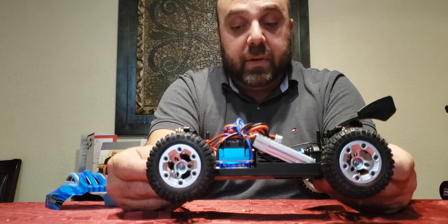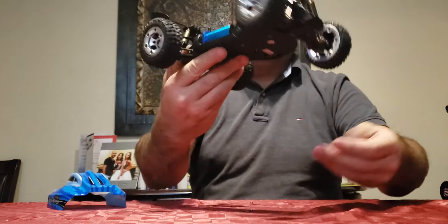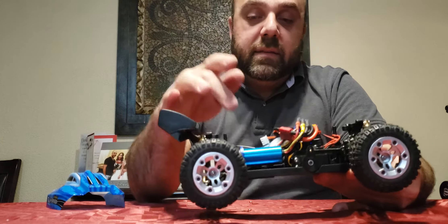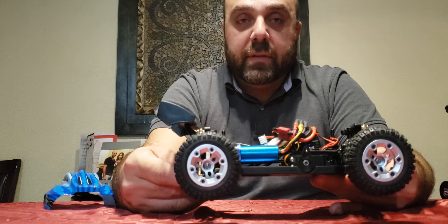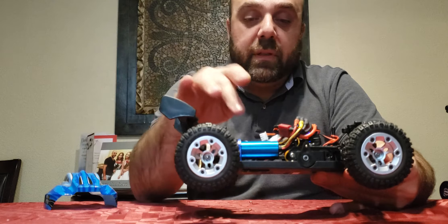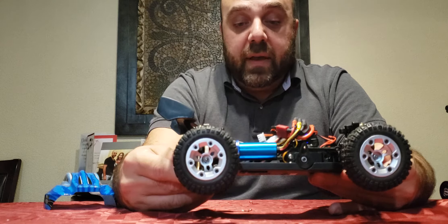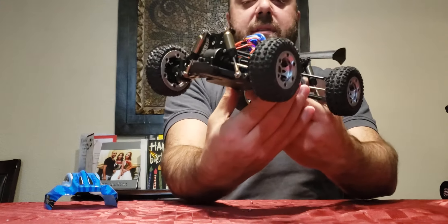I've tested this on 3S already just on the bench and it actually works, but the wheel speed is just way too much — it's insane. Over on this side I added a 2040-sized 4800 kV motor, and inside I've upgraded the pinion to a brass 17-tooth 0.7 mod motor pinion, which matched perfectly with the smaller shaft coming out of the motor. On 2S it's got lots of wheel speed; on 3S even more. I'll give you a sample of what it's like on 2S.